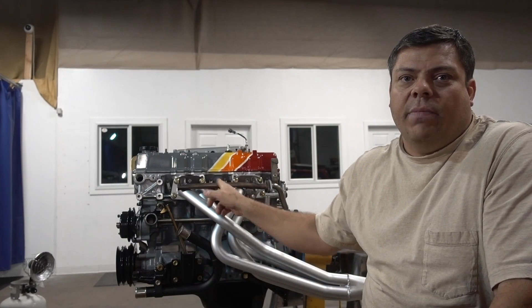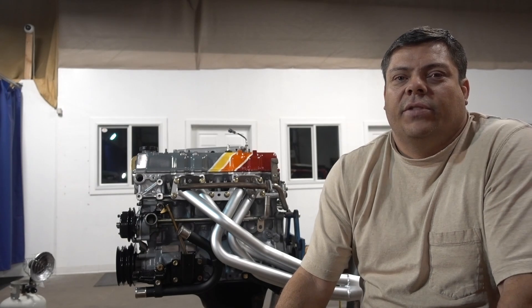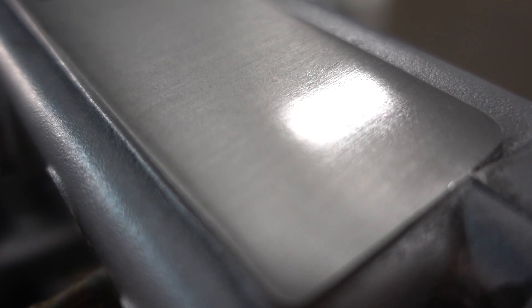I'm keeping all this stuff because I'm in California and I won't pass a smog test if I delete any of it. So if you're in a non-smog state or off-road only, you can delete this stuff and make your engine compartment as clean as you want. But I have to keep it all and make it work, and we have to understand how it works if we want to keep these things on the road. I hope that wasn't too much information, but I see a lot of misinformation about how EGR and air injection systems work and when to remove them. Thanks for watching.